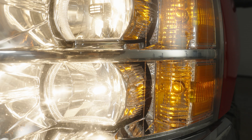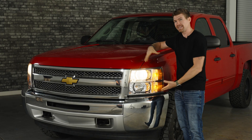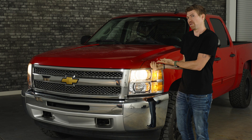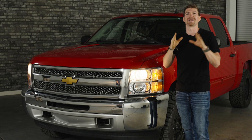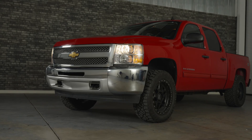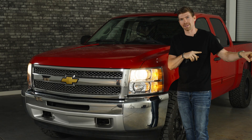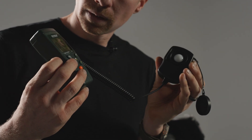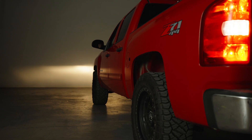If you're going to upgrade the high beam as well, that's a 9005 bulb. This entire headlight housing is a reflector-based headlight housing, and it's really easy to get a bulb in here that would fit but isn't very good — it'll scatter the light all over the place and give you a pathetic beam pattern. So what I'm going to do now is install it. I'm going to put the stock low beam on, show you that as the benchmark, then do the Ultra 2 bulb that came out years ago from GTR Lighting, and then the Ultra 3. I'll be using a digital lux meter to find the actual usable brightness at the brightest point on the wall, backing up 10 meters from the wall.